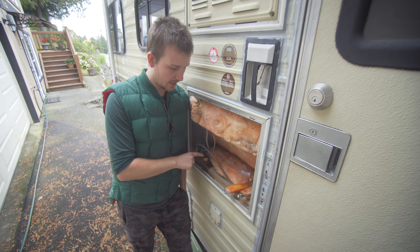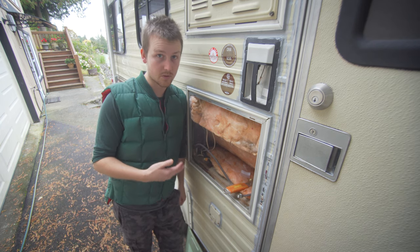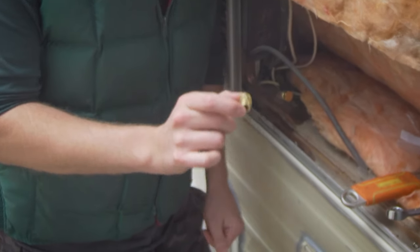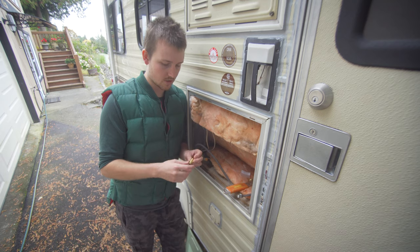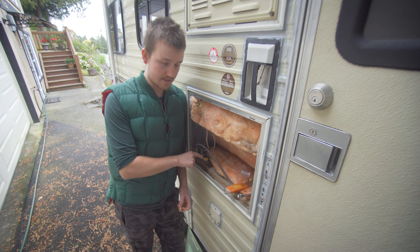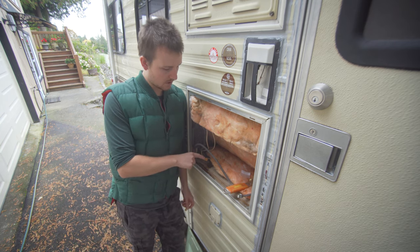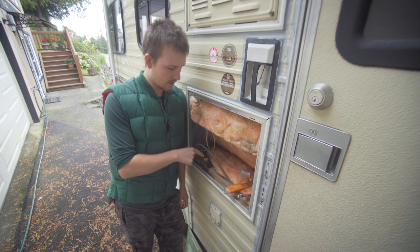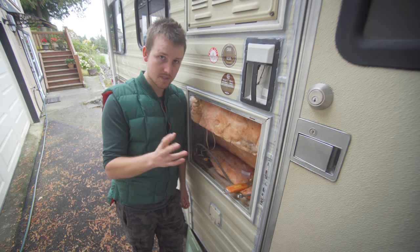Closing off this end cap of this propane actually caused a lot more issues for me than it really should have. I'm a complete novice when it comes to gas fittings, so I made the mistake of going to the plumbing section and getting a male-to-male fitting with a cap on it - and the cap I put on stripped it, so propane just leaked through. This isn't what you need to do. The exact part you need for this system is a 3/8 flare cap and it needs to be for gas systems. It wasn't at any hardware stores, so I went to an RV store. I said I'm taking my three-way fridge out and they knew exactly what part I needed. It cost three bucks. I put a little bit of soap on it, and if there's any bubbling it means there are leaks - there are no leaks.